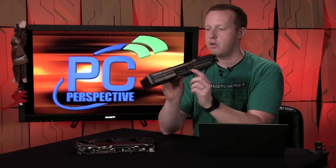Total memory bandwidth is 512 GB/s, so memory bandwidth is the same between the Fury and the Fury X. You do have fewer texture units — 224 on these GPUs as opposed to 256 on the Fury X. When we get to benchmarks, we'll see if that actually affects anything. Both cards still have two 8-pin power connectors, so they're the same in that regard as well.